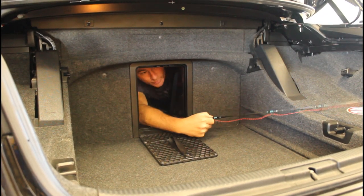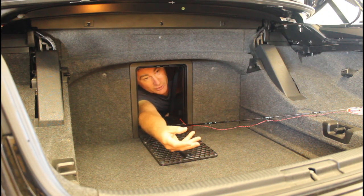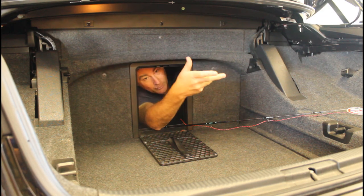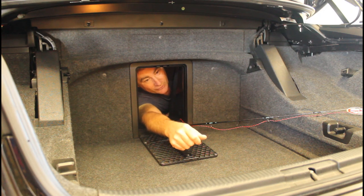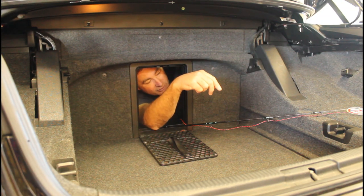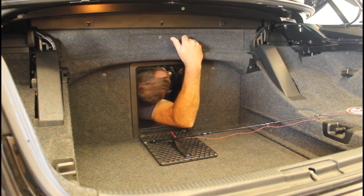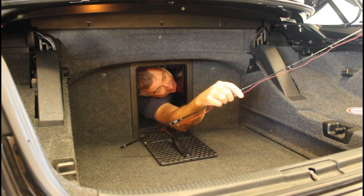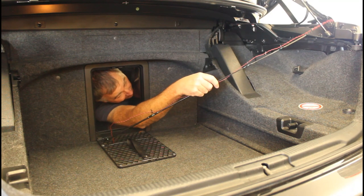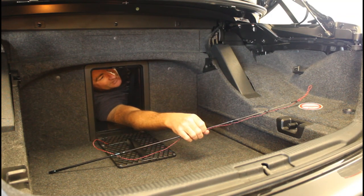We're ready to go fishing. For the purposes of showing you the video I've currently got the boot open, but one of the big problems you'll have is the rear divider that sits in here — you've got to work that off both hinges and pull it sideways. It's quite tricky in a tight space, but you just swing it around and put it over to one side so you can reach into the corner and see what you're trying to do. I'm not the smallest person in the world, but if I squeeze myself around a little bit there's enough room to stick my head through and one arm, and that's enough using a fishing rod end to reach over where I need to be with line of sight. If you've got the V6 one you've got two batteries sitting there so I'm not sure how that works, but that's not the problem I had.